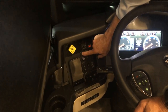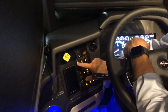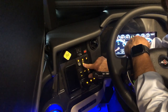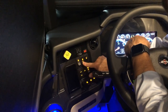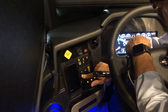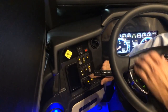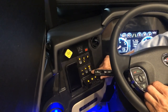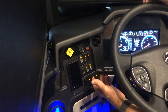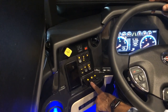This first switch allows headlights to come on automatically. You can also turn the headlights on or off with this switch, and here are your fog lights on and off. To dim the backlighting, go dimmer or brighter. This is your dome light on and off. For high beams: auto high beams cancel is down and resume is on, so you don't have to adjust manually. The ATC automatic traction control override is here — on is standard, momentary is off.